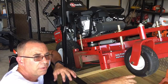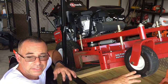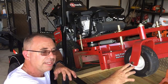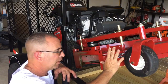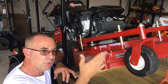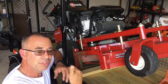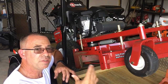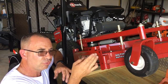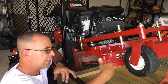That's okay if it happens just a little bit — go back over it once or twice. The problem is when you start getting really large clumps and you're bogging the engine down. That's when you definitely have the wrong blades and you're going to want to get gator blades. The mulching kit blades for this mower are the ones with the alligator serrated back — those are mulching blades. Instead of creating a lot of wind and pushing material toward the side chute, the serrated wingtips chop up the clippings and put them back in the lawn rather than throwing them out.